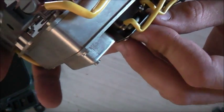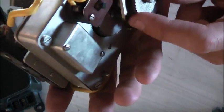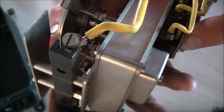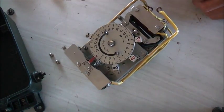Very interesting though — it's like a little... I'm not quite sure how that works, but it pops out like that when it's finished winding. You can see it goes one way — there's a little latch mechanism in there. I've got to be very careful with this; it's very well made, this switch. There's a little spring in there which makes it go one way. It turns very easily, so it doesn't really need any oil. This is the main concern — why it wasn't working. So I'll give this a bit of a clean, polish those contacts, put some contact cleaner in there, and this thing should work again. It's very accurate and doesn't lose track of time. I'll get those switch contacts clean and it will be working again.